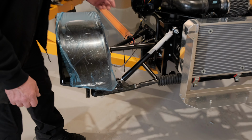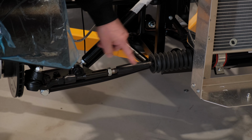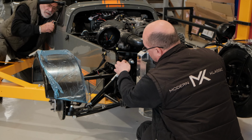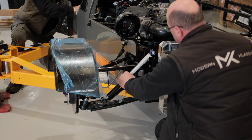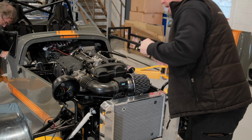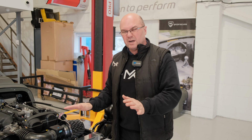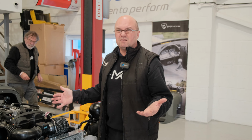So we've got the geo at the front end, which, if you haven't done it before, is basically this lock nut here, and this rod you rotate left and right to set the tracking up on the steering. Then we've got to set the ride heights, which we do on the push rods. There's two little lock nuts here, a left and right thread, and you can wind this, and this winds the suspension up and down. Now with the dampers, you want to give them a little bit of preload, so you wind the spring up so it seats on the platform. On this one you've probably got about eight actual threads showing that's preloaded, and that gives you a good base setting. Set all the damper clicks to 0, make sure they're on 0 when you're doing all the geometry setting. Once you've done it all, you can put them on to 6. Same as on the rear, you'll probably be on 6 as a road setting as standard.